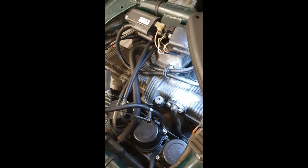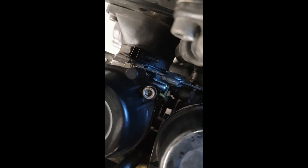To show you where the screws are: there's one screw that adjusts between carbs three and four, number three is your master carb so you're balancing everything to that. There's another screw adjusting between carbs three and two — very fiddly. And over here in the middle there's one more. The best approach: balance one and two together, balance three and four together, and then balance the two pairs together.